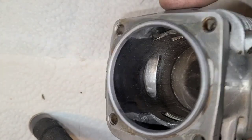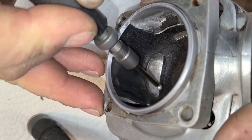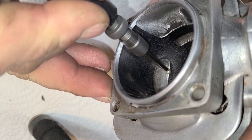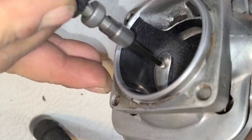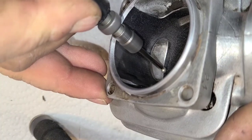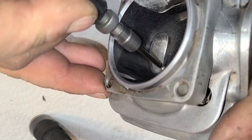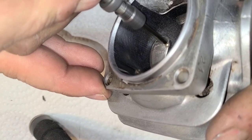Now, you don't want your chamfers to be too big. Just enough is what I say. But again, I just know what I know. And if you make your chamfers bigger and they work, I'm cool with that. Remember, if you don't do this, you will scar that piston up real bad. Be mindful of that stuff when you're checking your timing. At least hit this with sandpaper if you're going to check your timing. You don't have to chamfer it right away, but...